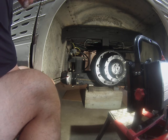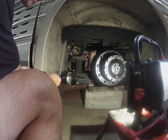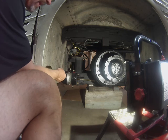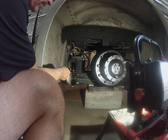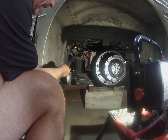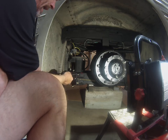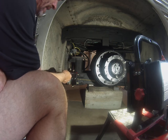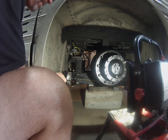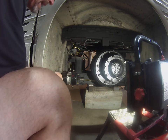Once you get your spring brake and say okay, what do I have to do to get this thing mounted — the first thing you'll do is remove the old service brake, which unbolts from a bracket that's similar to this bracket here but mounted right about in this line. You unbolt that brake can and get rid of it. The next thing you need to do is actually cut this suspension component here, which is a rectangular tube. You cut it from the back to be even with the face of this plate, because the round shape of this spring brake extends into that tube. This spring brake is about eight inches in diameter.